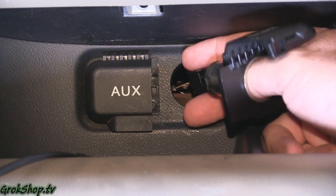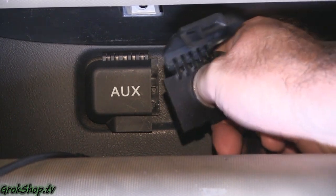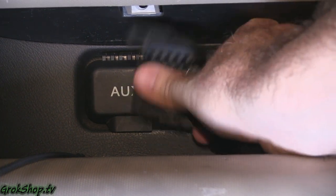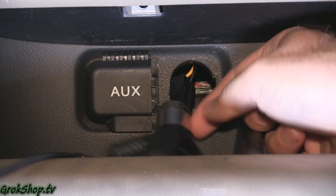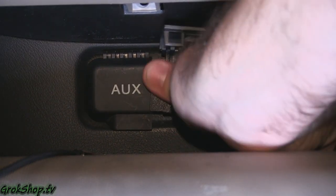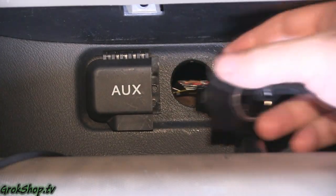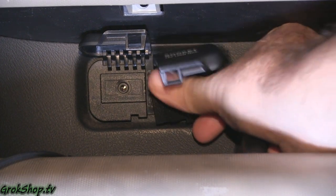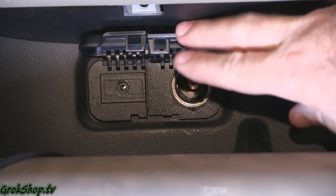Note: I've got my thumb in the socket here — don't do that if your ignition is turned on and your battery isn't disconnected, or you can get a pretty good shock. My car's ignition was off when I did all this, so no big deal. If you're having trouble getting your 12-volt accessory socket plug back in, raise up the aux port cover if it's not already open — it seems like it can interfere with the accessory socket going back in. There we go, that's how it's done. Thanks for watching.